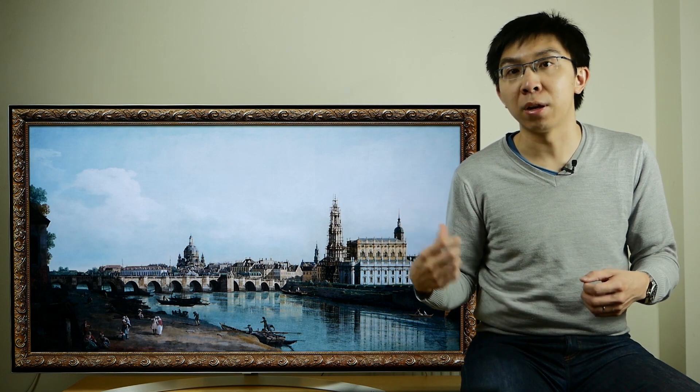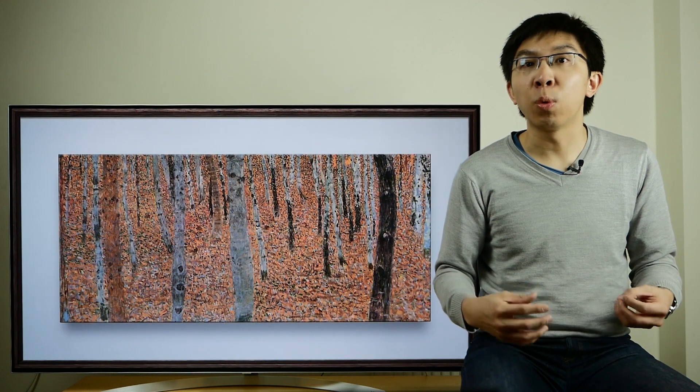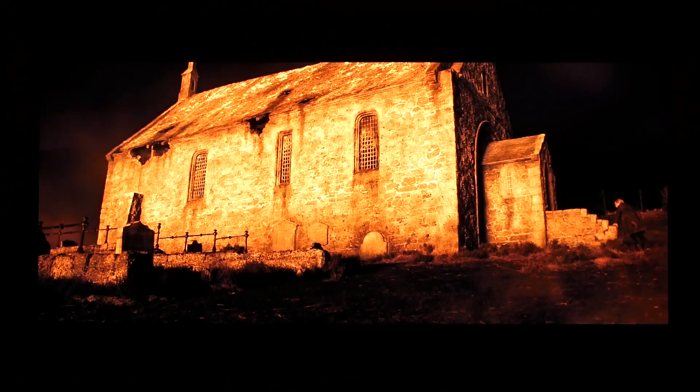Here's the amazing thing about LG's 2017 OLED TVs including the OLED 55B7: the engineers have designed them such that if peak white is calibrated to 150 nits, there is no ABL at all, as you can clearly see from the same test pattern. Why is this important? It's all to do with contrast, which can be crudely defined as white divided by black, and contrast is the number one determinant of picture quality according to the ISF, or Imaging Science Foundation. We all know that OLED TVs are capable of zero cd/m² blacks, so the most straightforward way to get higher contrast is by brightening the picture. To be fair, this increase in perceived contrast is not very visible in movies, which is why many publications understate the importance of reduced ABL. The average picture level or APL in movies is usually below 10%, especially when top and bottom black bars are taken into account.